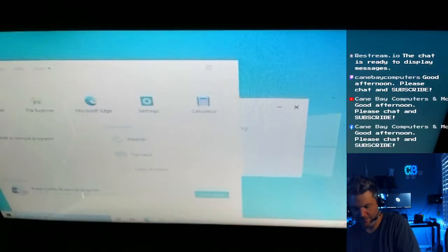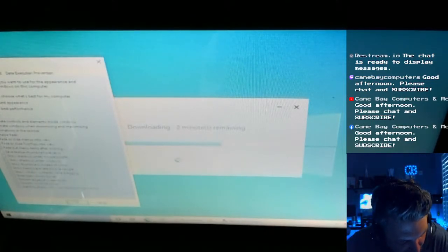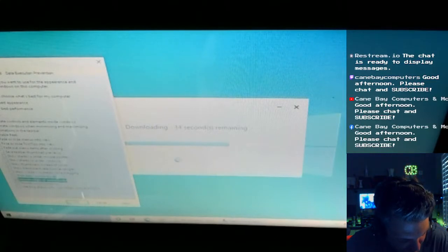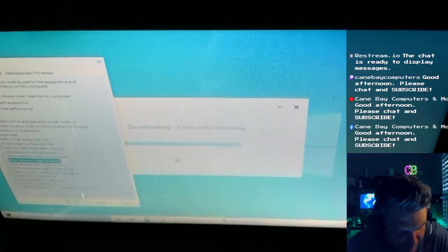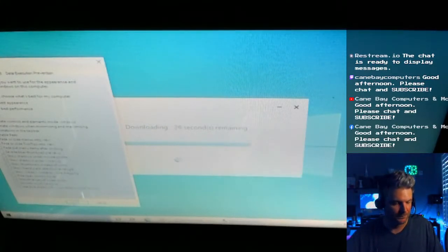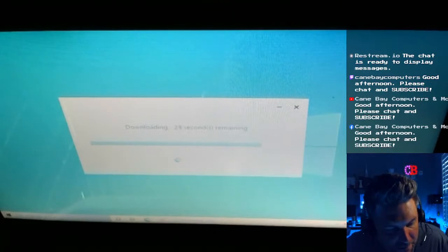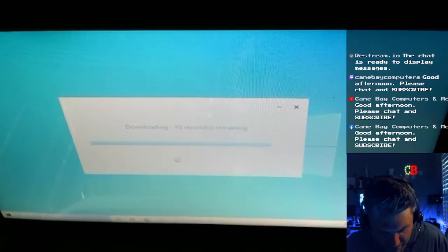And I also set the performance. There's a performance adjustment. I do custom. First I click Adjust for best performance. Then you definitely want smooth edges of screen fonts, and you also want to show shadows under windows. Yes, you definitely want that, because it's hard to see. I don't know why they just don't put a normal border around the windows. Kind of ridiculous. Okay, that's good. I'm gonna remove that. Are we online? Network access, okay.